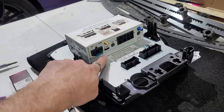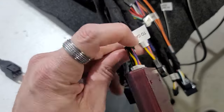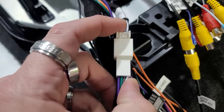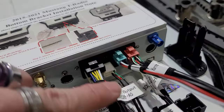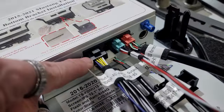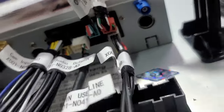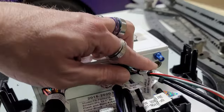Here is the CAN box right here where the white plug plugs in. This is for the 360 camera — these are all going to plug into the factory harnesses. If you have a non-amplified system like us, you plug these together and that all runs into here. Here are all the color codes for the harnesses: you've got black, green, red, white, tan, and gray down on the bottom. There could be more open slots as well.